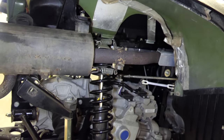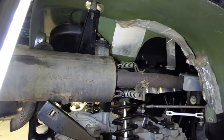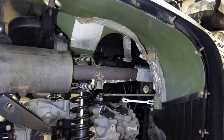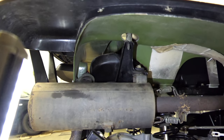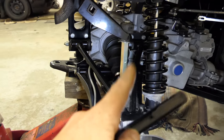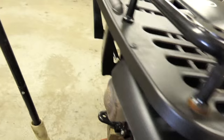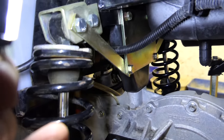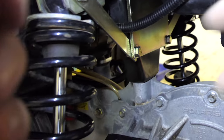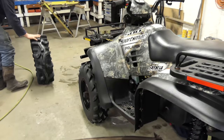To install the passenger side top shock mount it was a pain because your shock bumps into your exhaust and there's not a lot of room. So we loosened the exhaust bolts — one here, one here, and one right there — and also loosened that up too. Then put your bottom bolt back in, hook in these two little arms that bolt up to that plate, hook those two up on each side, then tighten everything down and you're good to go.